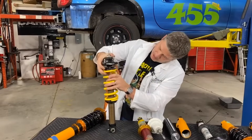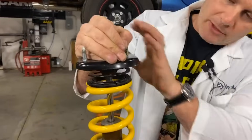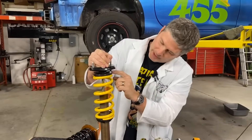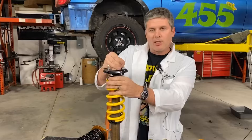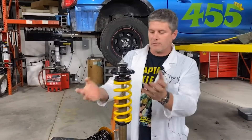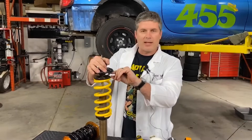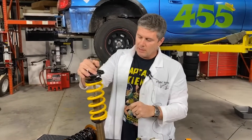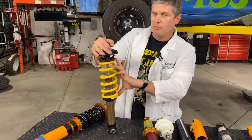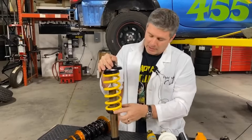In the front of a Miata you get to the point where the spring starts to hit the control arm, or it might hit the axle in the back — so that's too long — but the minimum you need is enough to cover your shock travel. Now, as for helper springs — once the main spring is fully unloaded, you're not getting a lot of benefit out of that last little bit of travel. The helper spring is basically just there to keep everything together. Otherwise when you lift the car off the ground, all the hardware can literally just fall out of place, and then you put it back down with the springs sitting crooked and stuff goes bang. They don't have a big dynamic effect unless they are a fairly heavy rate like on the VMAXs. If your helper spring is fully compressed all the time, it's not doing anything — you can take it out and just move the perch up a little bit.